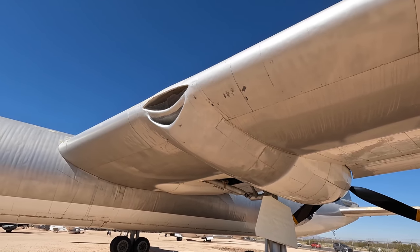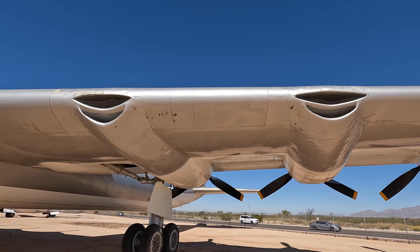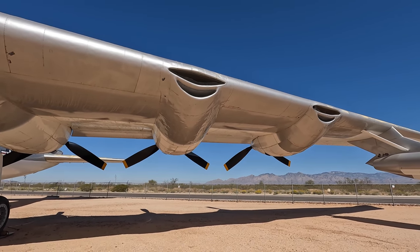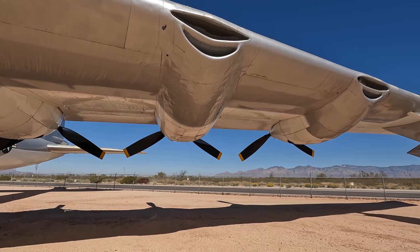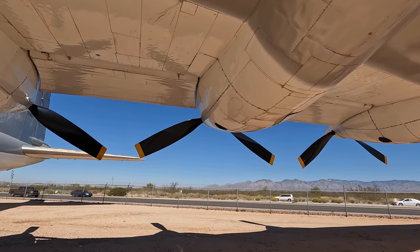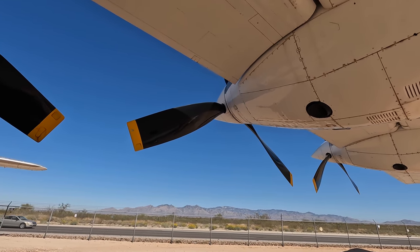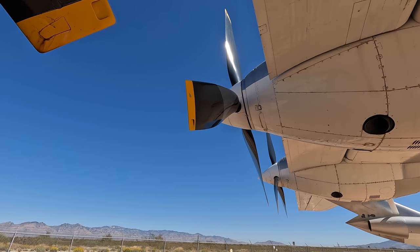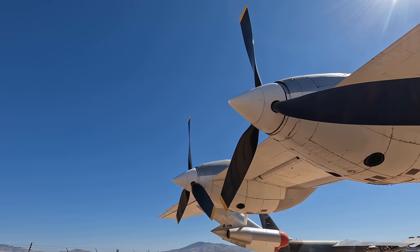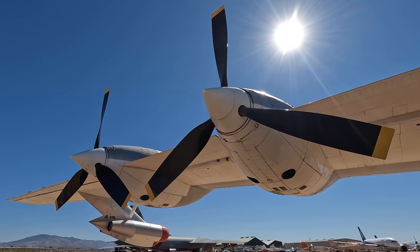This was designed before in-flight refuelling, so the wing had to store a huge amount of fuel. An absolute priority was high altitude efficiency — having the engines behind the wing avoided turbulence interfering with the airflow over the wing. The leading edge was also very thick, so forward-facing props would push directly back into it, reducing efficiency. Because of the swept wing design, the propellers would also become dangerously close to the wing tip. All of these problems were resolved by installing the prop engines in a pusher configuration.